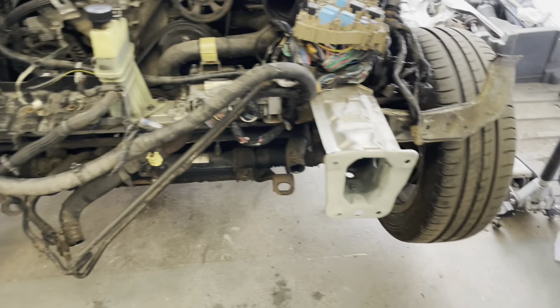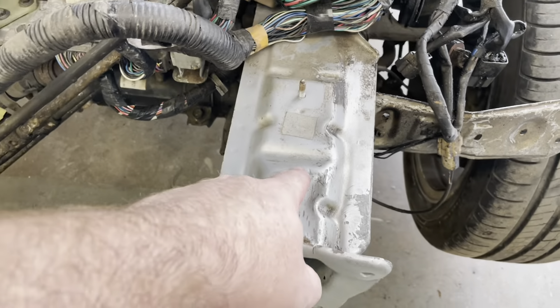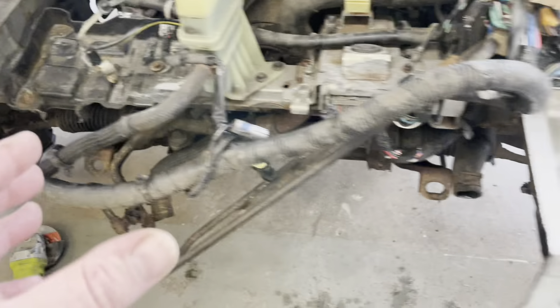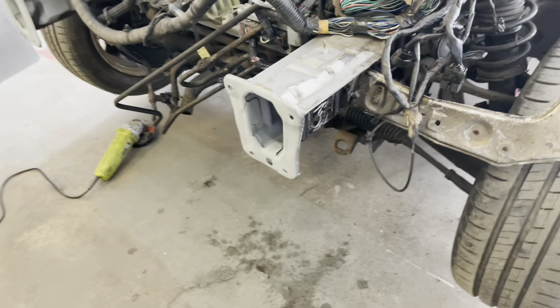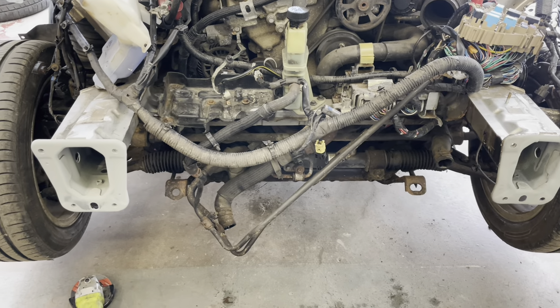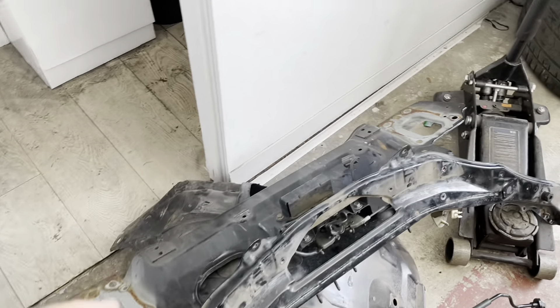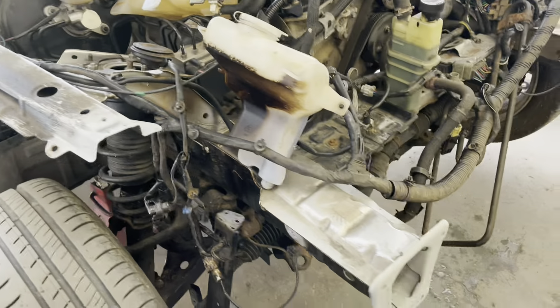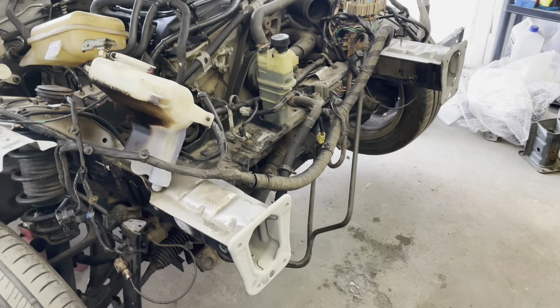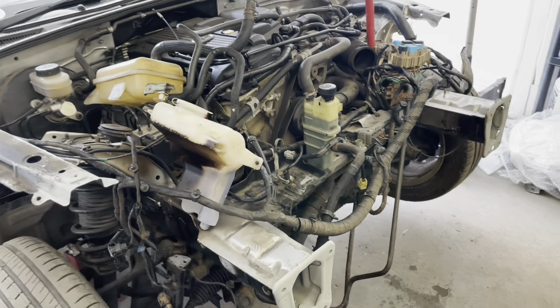There we have it — one straight chassis. We'll need to do a wee bit of body filler just to take that small dent out, but I've measured the tops of the chassis legs and they're both identical, exactly the same width. We got the dent out of the inside — it's looking all good on this side. We've test fitted the new crash bar and it fits perfectly. So what we need to do now is weld on the new front panel. It's very hot and sweaty — I need some water, lunch, and a wee break for half an hour, but we've got it done.